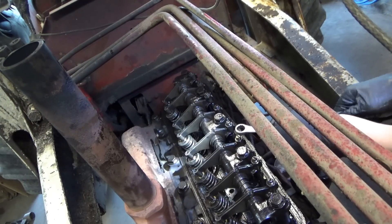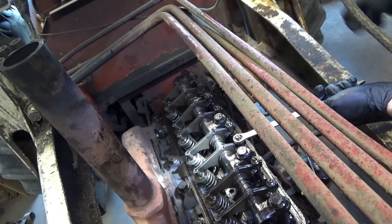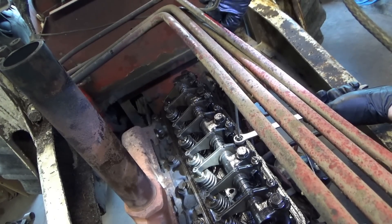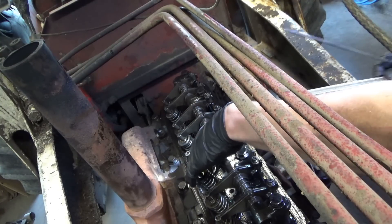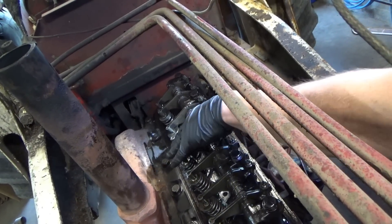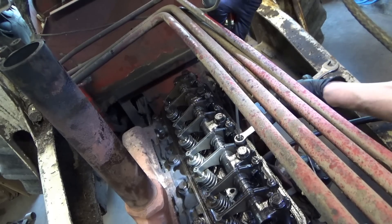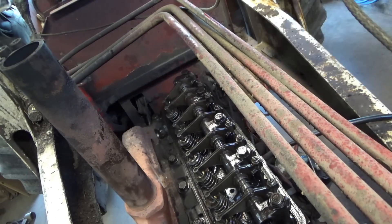This valve right here is the one we're worried about. Let's see how tight it was. I'll turn on the air. Half turn, one turn — there we go, now it's sealing. One and a half turns, two turns... one and a half turns — that feels about right. Crazy stuff. So now when we crank it over, we should see the correct compression, and obviously we'll adjust all the valve clearances here to spec.